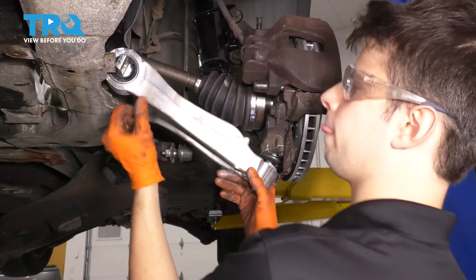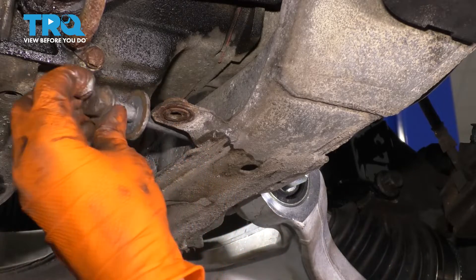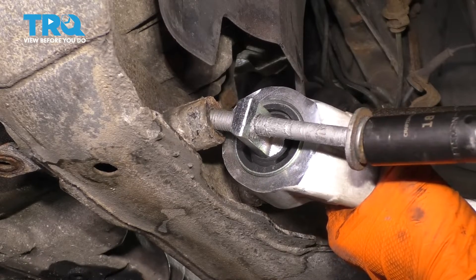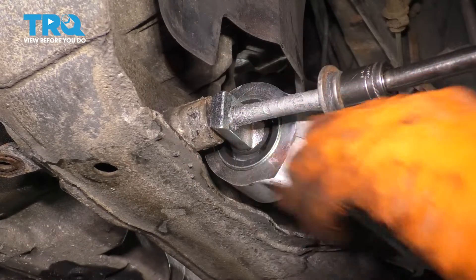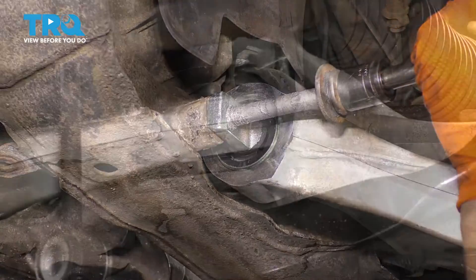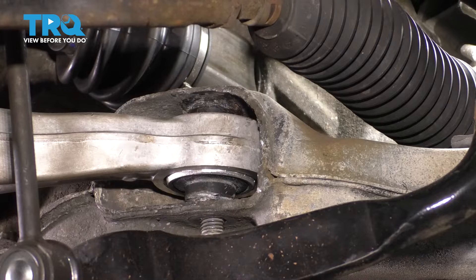Now we have to line everything else up. It's kind of in place, but it needs to go up so it can actually line up parallel with the mounting holes and the bolts. To make the front bushing line up, I'm going to take out this front bolt — which I coated the shank of in anti-seize — and thread it in at the front here. I'll take my 17 millimeter socket with a long extension and pry this up; this is actually going to twist the bushing up and hold it in place, lining up the bolt with its mounting hole. Then I have a long pointy punch to drive through the hole, persuading it into place. Finally, slide the bolt through.